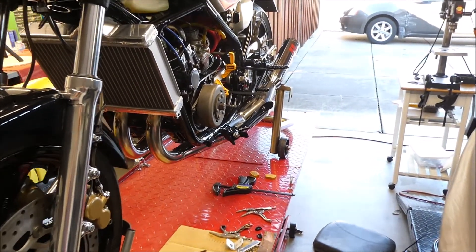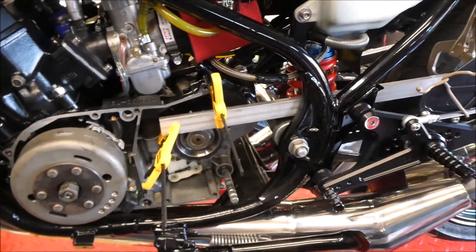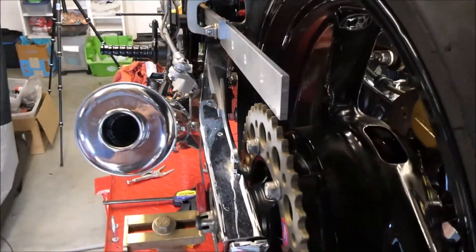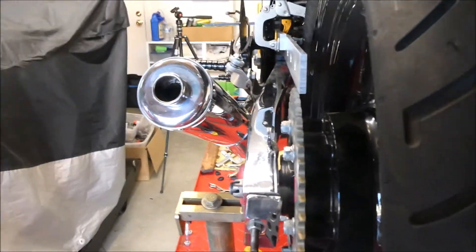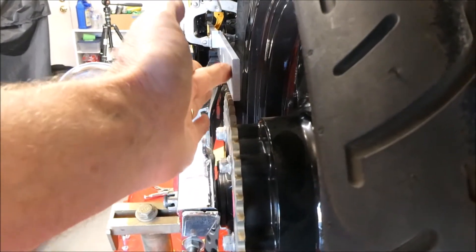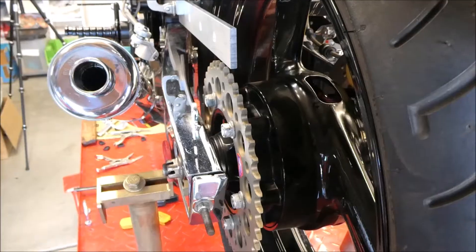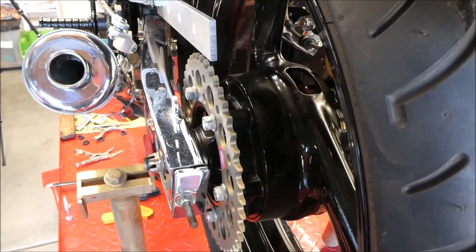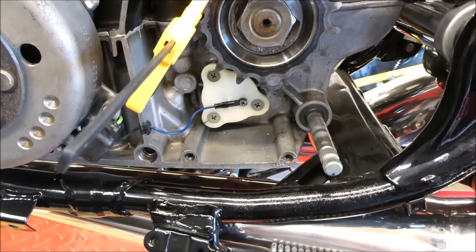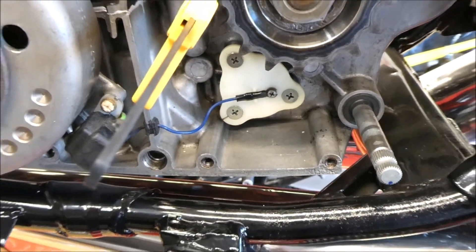We're making some progress. The bike is back up on the lift. I have my chain alignment rig set up and it says I need to shave off of the sprocket carrier this much — the outer edge of this sprocket right here should be flush with that. I'll get my caliper out, measure that, take the rear wheel off, the studs out of the carrier, and hand it off to Julian to machine it down. I'll keep an eye on this neutral switch and make sure I don't develop an oil leak again. That was an easy fix — I'm pretty sure that did fix it.